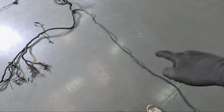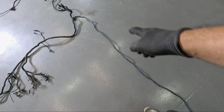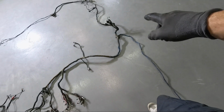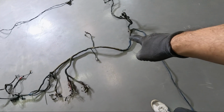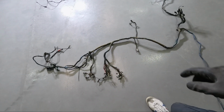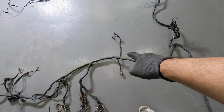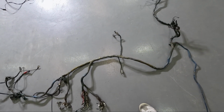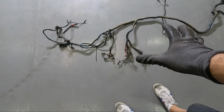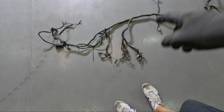on the underside of the body shell, on the underside of the rear deck lid. It then goes down the side of the car, next to the sill under the carpet, and comes up the A pillar. Then this is the piece that runs behind the fan blower motor along the inside of the bulkhead, and you have the cable that goes through to the positive side of the battery.